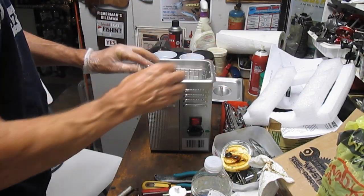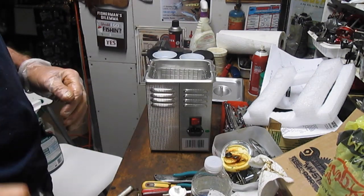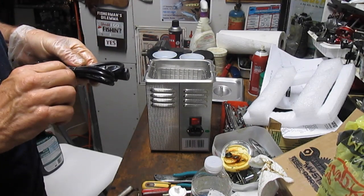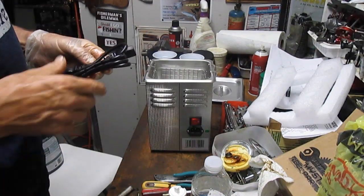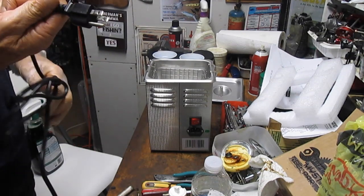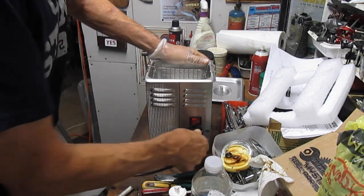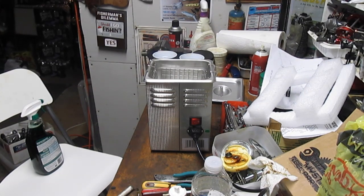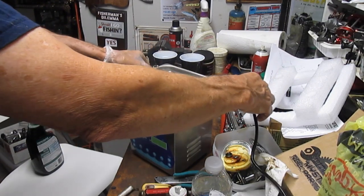It says we should put the parts into the basket as opposed to placing them on the bottom. Let's go grab the wire — the wire is a grounded wire, so if you're working with an ultrasonic cleaner with water and electricity, please make sure you have a grounded outlet. Don't shave off those ground plugs for convenience. Let's plug that in — this is actually the back of the unit, so we'll turn it around after.